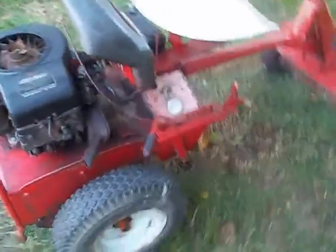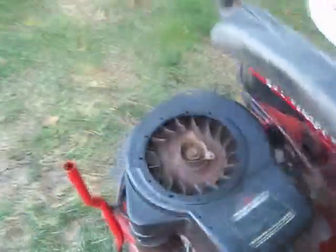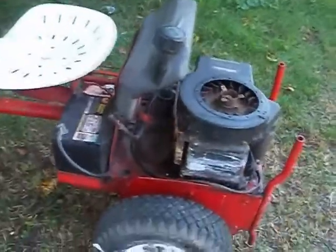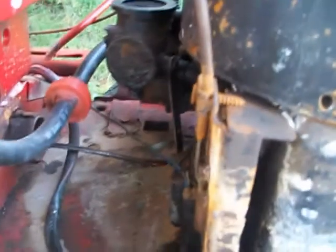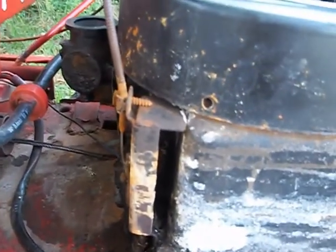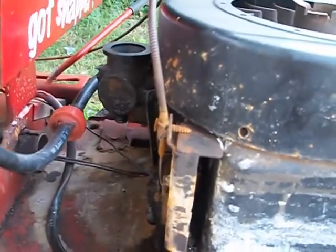This video is far too messed up - I tried to do something for you. What I learned from my own experience: when you get a leaky carburetor and a shutoff valve, it's good to turn the shutoff valve off and then restart the engine so all the gas burns out of there. I don't think I need to rebuild this - it burned off the gas that was leaking. I hope to get my deck finished soon. You guys take care.